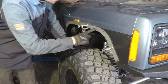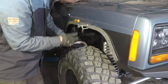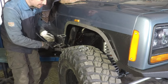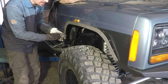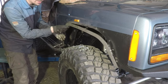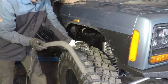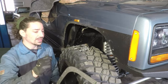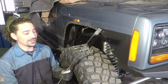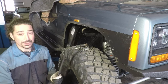This is all drilled now to M6, so we're ready to take this off and go into the other garage where the oxyacetylene torch and the tube bender are. Then we can bend the tube and check it against the template. Sadly the tube bending machine is very inaccurate — it's a bit of a process of doing it by eye rather than actual measurements. Sometimes it's easier to just buy the tube with the bends already in and use a thinner diameter tube inside to give it strength when welding, so you can build it more accurately. In my case I'm using one solid piece of tube, so we'll see how it goes.